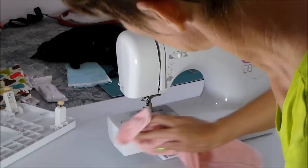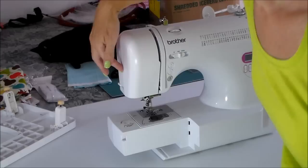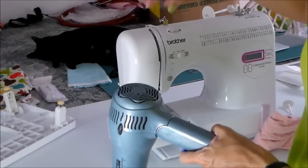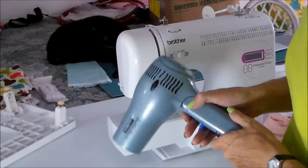I'm going to work more on this area at the top of the machine. Some of yours may have a clip so this part will swing open; some may have a screw hole in the side. Mine is fixed and can't be opened at all, so I can't get to these areas inside very easily to dust them. This is where my hairdryer is going to come in handy — I'm going to switch it to cold and blast a little bit of air down through these channels to blow any dust out.